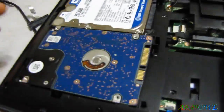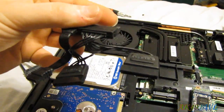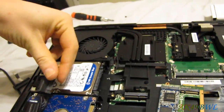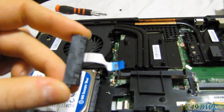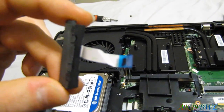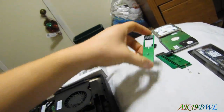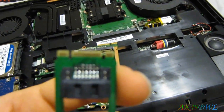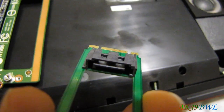The way this cable is going to work means placing this hard drive upside down, because unfortunately the cables are not long enough to reach all the way across. You also do not want to stretch this cable too much, otherwise you could rip it and that would be a major problem. The next item needed is an M2 to SATA port adapter, which is exactly what we need for this project.